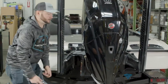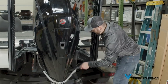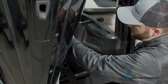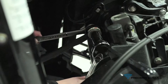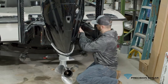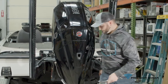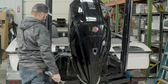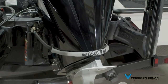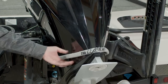Now that we've got that snugged up, we'll go to the other side and repeat that step. Once both sides are done, we'll check the trim to make sure it's not going to constrain the motor when trimming all the way up. As you can see, it's able to trim all the way up and the leash is not impeding the motion.